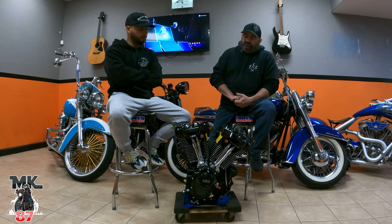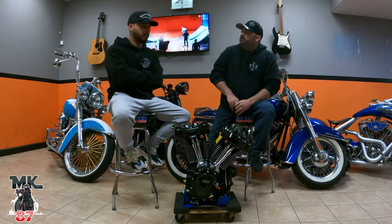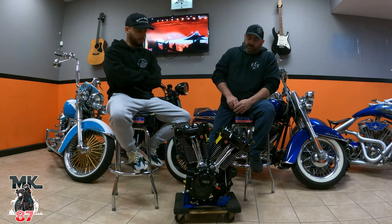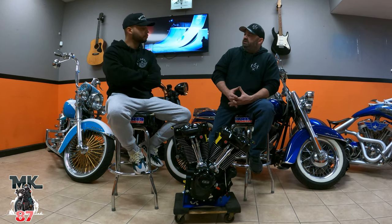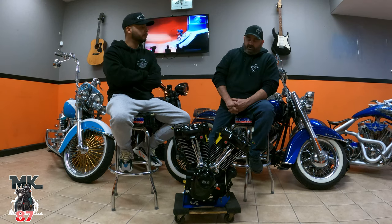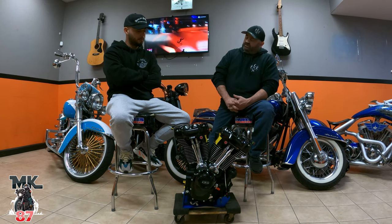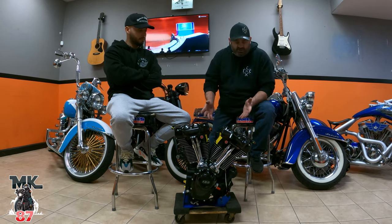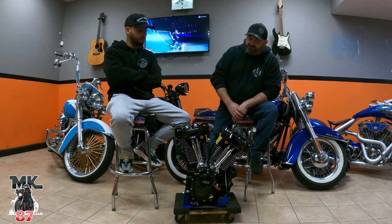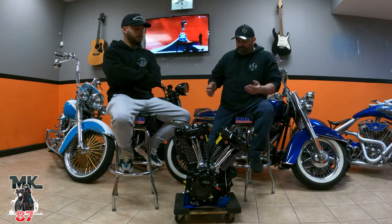We're going to do the Fueling head breathers inside. As for the manifold, throttle body, and all that — it actually comes with a paired 68-millimeter manifold and throttle body and 6.8 injectors. So we're going to run as much Harley stuff as we can. The motor comes very complete — it comes wet, it's got spark plugs in it, it's got ACRs in it, everything's in it.